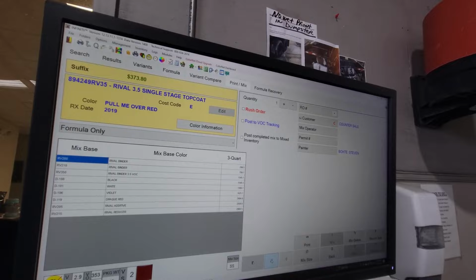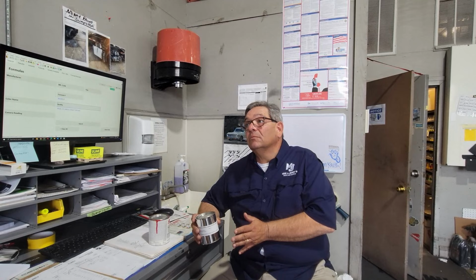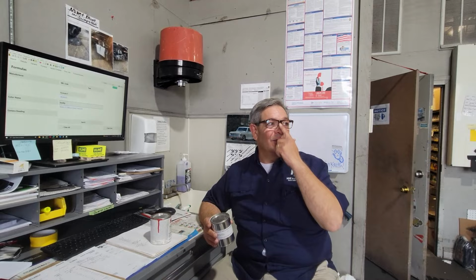So the second color is this, what we think is 1957 India Ivory. When I called you and said, "Do you have a formula for this?" you said, "Well, sort of." The original base coat in the automotive industry was DuPont chroma base. A lot of those older colors were painted originally in DuPont chroma base. But all of those old cars were converted into the chroma base system. Now it's just called Chromax. I did see that. I think I saw Chromax on the hardener for the Imron. Probably. Yeah.